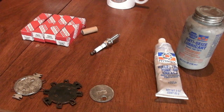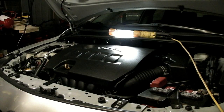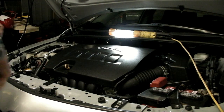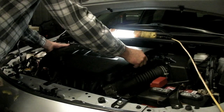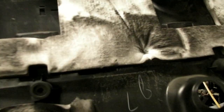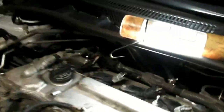You're also going to want to gap your spark plugs. To get started, you're going to want to take the plastic engine cover off — that just snaps on. There are some little rubber inserts on the back, there are four of them. Then you're going to want to make sure the top of your engine is nice and clean where the spark plugs and coil packs are. There's a lot of dirt in here — you want to blow that off and clean it up good.